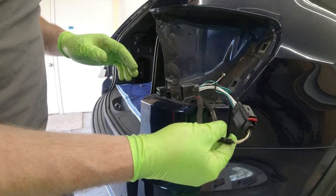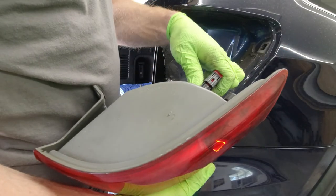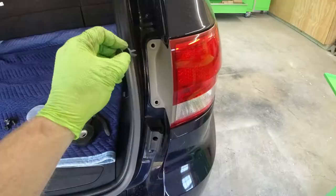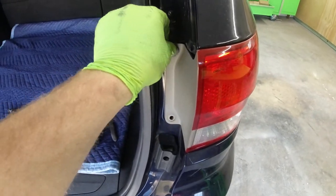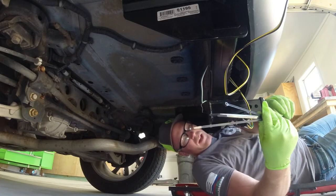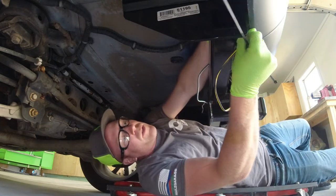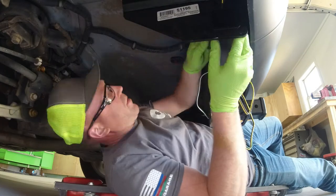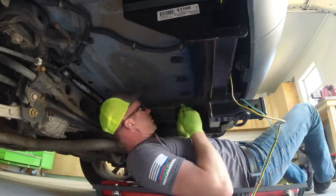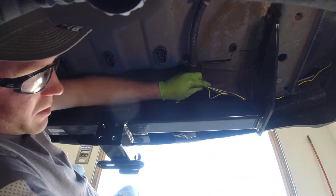All we've got to do is put our old tail lights back in, and we'll go down underneath and zip tie everything up so it's nice and neat and out of the way. Zip ties did come with the kit, but I'm going to use a slightly longer zip tie from my shop just to zip tie the wire right around the frame. Then we'll take the excess wire and zip tie it to this hole right here.